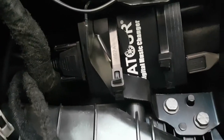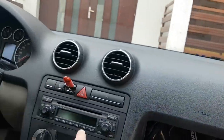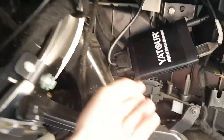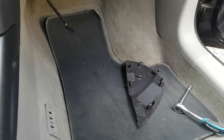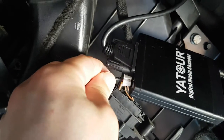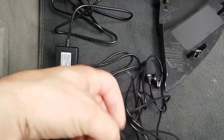Once I take off the glove box, here you can see the YT-M06 adapter which I added more than 2 years ago. After releasing those zip ties, we have a better look. Here I have the extender cables for USB and AUX, which go all the way up to the radio where I have connected my USB stick. On the front side of the YT-M06 adapter there is a connector port — that is exactly where the Bluetooth module connects to. I will take my Bluetooth module and connect it to the YT-M06 adapter. Once connected, I will also connect the microphone to the Bluetooth module, after which the module is ready for testing.